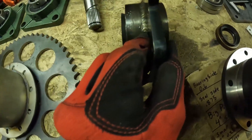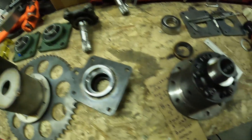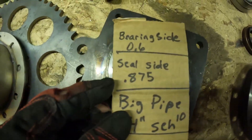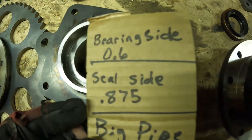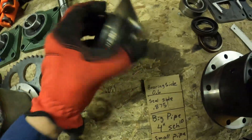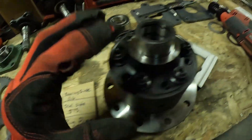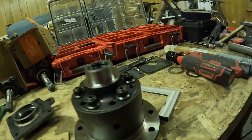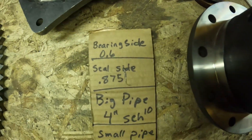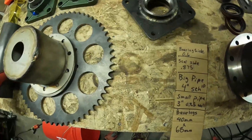What I've got on this one — this plate is three-eighths thick. I have the other two measurements on here for the length of pipe. You want these bearings to be a press fit; you don't want them loose at all, because you can't have a snap ring to hold them in since we don't have enough room on here. So we're going to cut two lengths of pipe to those measurements out of our 3-inch quarter-wall pipe, then weld them on these plates.